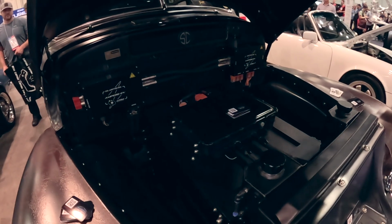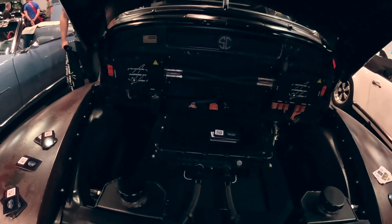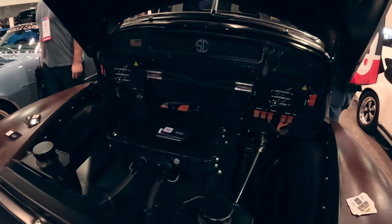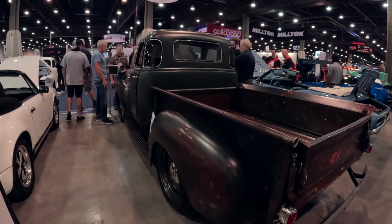This is a 42 kilowatt Ampere EV electric system, which has the battery packs, Cascadia Motion IM 225 motor. It's a rear drive unit with a Ford 9-inch rear end. It's sitting on a Roadster Shop chassis. It's a spec chassis. We kept it basic. This is our test vehicle and our mule so that we could test all the components, make sure they work like they're supposed to work.